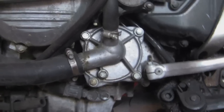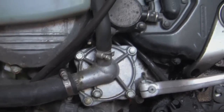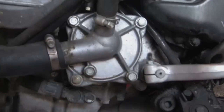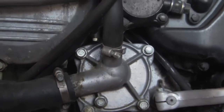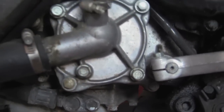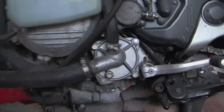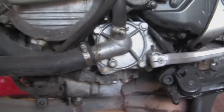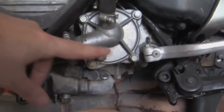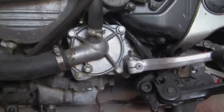This guy right here — this is our water pump. We have an in hose and we have an out hose. There are five bolts: the four that run the perimeter are what actually hold the water pump to the bike, and then this unique fellow right there is our drain plug. It's put there for a reason — it's located pretty much at the lowest point of gravity for the coolant system, so that's a really logical place to put the drain plug.